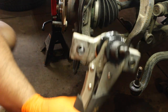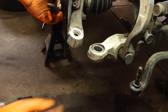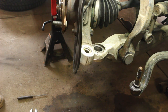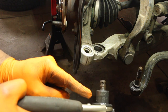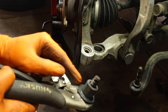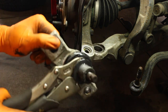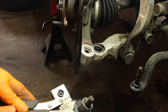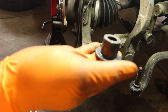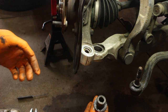So that's what I had to do to get to it — not what I wanted to do, but it worked. I was worried that the hole looked wallowed out, but it didn't. It seems what happens is there's also a little collar piece that fits up inside there to make this whole thing work. And it just came off on its own. So that actually fits up in there, and then the ball joint goes in there. Let me go ahead and clean this up.